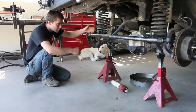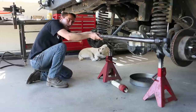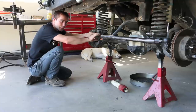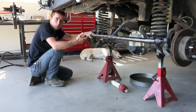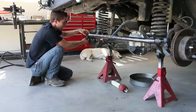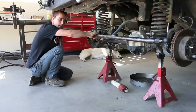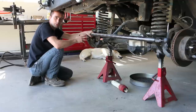We had to bend our tie rod in two spots to gain clearance around some components on the axle. If we had a straight tie rod, or had done this under the knuckle allowing a straight tie rod, toe adjustments would be very simple by traditionally spinning the tie rod — you can use a pipe wrench. In this case, to get toe adjustments, we'll actually have to take one rod end out of the knuckle and spin the whole tie rod in and out to get the toe set right. Not a big deal — it's just a trade-off due to this particular setup.